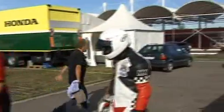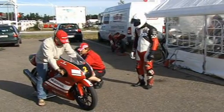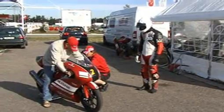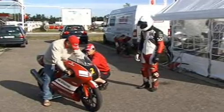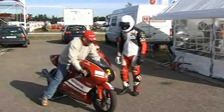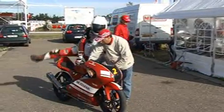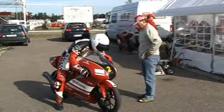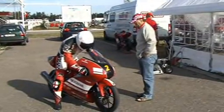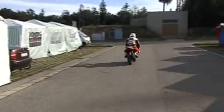Morning warm up, Sunday morning. I had to try the clutch and we'd had a little mess around with the 450 again. I was determined to try and run this bike because it was slightly faster than the 426 and suited the circuit handling wise better than the 426. It was the misfire, it turned out to be just too dangerous. The bike had cut out halfway around a long corner, and you'd end up almost losing the front end.